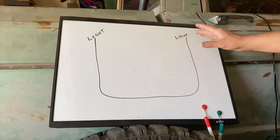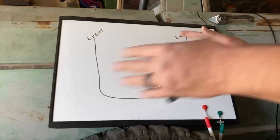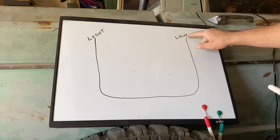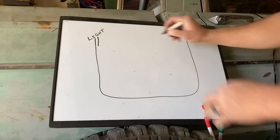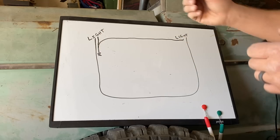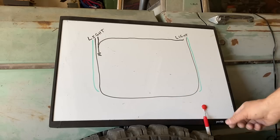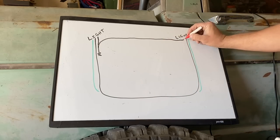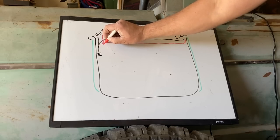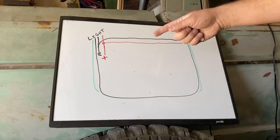Just because I know not everyone's going to want to wire each side independently like I did — though I find that way a lot more beneficial, since you can control the throw of the light — here's a simple diagram. You have your two lights on each side of the cowl. For the ground on both sides, just combine them and finish off your ground. Of course your turn signals have to be wired to each individual turn signal because they're on separate circuits — don't combine the green. If you want the white lights to come on together, just like you did with the grounds, tie them together and run it to your power supply so when you hit one button both lights come on.